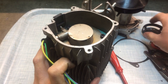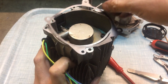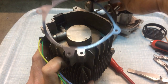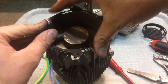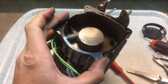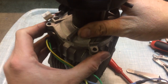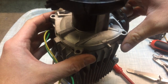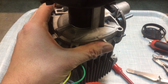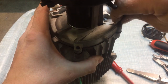Once we've got our glow plug all sorted, the next thing I'm going to do is install the other gasket. We've got a brand new one here. We're going to turn that around and put that on there, and then we can push the motor unit back on. Spin that around like so. This is a metal gasket — it's actually better than the old one, which was one of those fibre ones. Then we're going to get the four bolts, making sure we've got the washer on the end there. It's a locking washer, so keep it nice and tight.